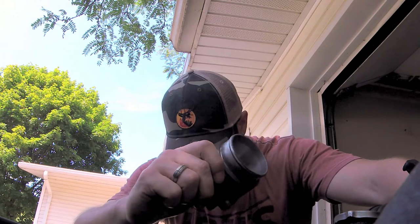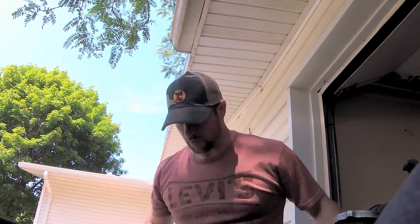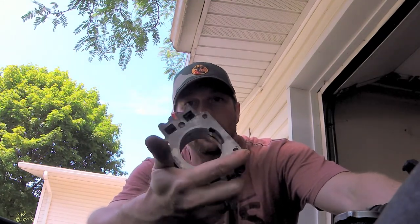But what I can do is use, where'd it go? Oh, I got it somewhere. A corded Dremel, a plug-in Dremel. I'm going to be using that and an adapted burr. A burr is basically, I don't have anything here prepared, but it's a cylindrical cutting tool, and it basically grinds or cuts away metal. I do have grinding stones that I can use on here, but this is soft aluminum and it'll just clog up a grinding stone. That's just going to be more work than it's worth.